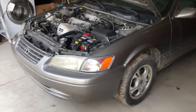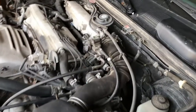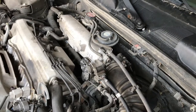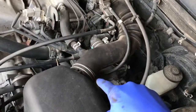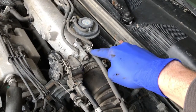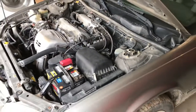Back out in the garage now — it's been three hours, plenty of time for that throttle body cleaning solution to dig its way inside and loosen up all that grime and sludge. I've reconnected everything: secured the air filter case, the clamps securing the rubber hose, repositioned it on its nipple, and secured it with the clamp.